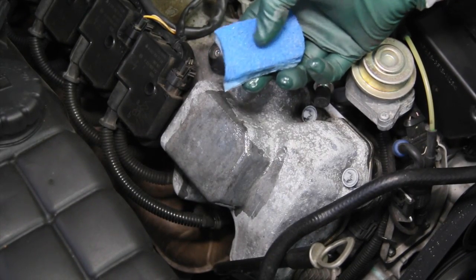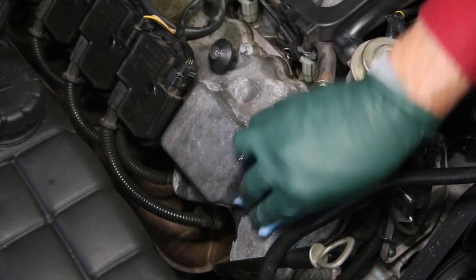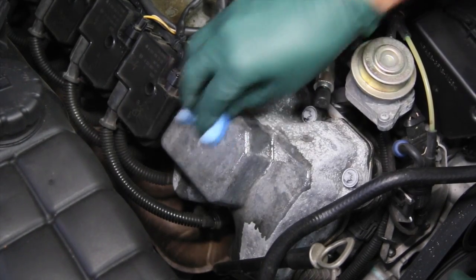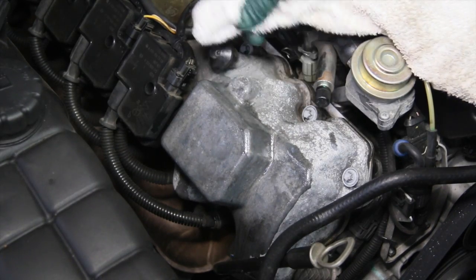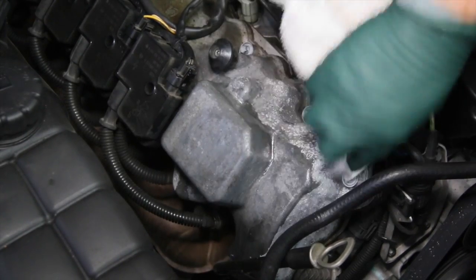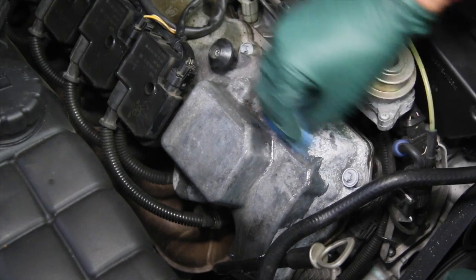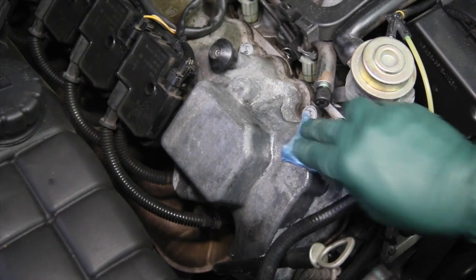By using this pad, it's not as coarse as some of them. You don't want a real coarse one — you don't want to scratch the magnesium. Once I start scrubbing away, this will get into the pores and get all of that corrosion out of there. I'm going to wipe a little bit of this off so you can see how dirty this is. I may do this three times — I actually let the sealer soak on here, then come back and scrub a little bit more. Look at how it's cleaning that discoloration.